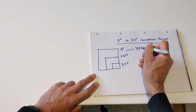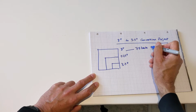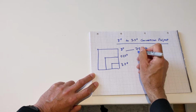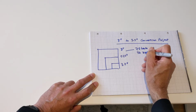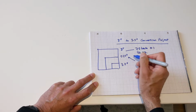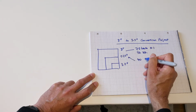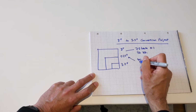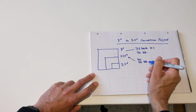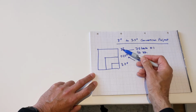So the original 8-inch diskette was 77 tracks and surfaces, let's call it from 0, two sides maximum, 0 and 1. There was also single density or double density. When the 5.25-inch drive came along to start with, we had 40 tracks. We had single density and dual density or double density. And as you can see, that's not going to be enough to replicate this disk.